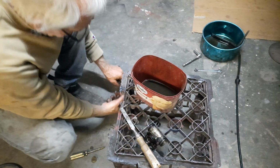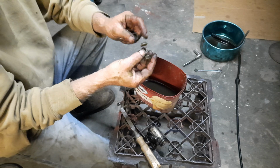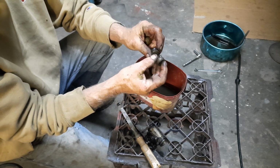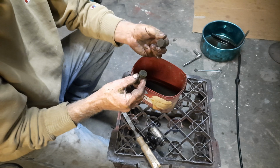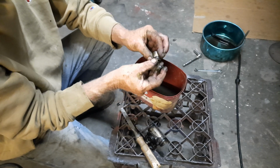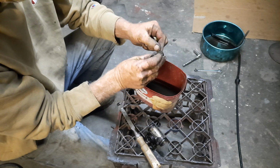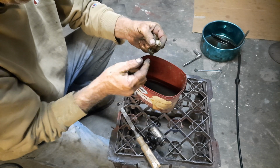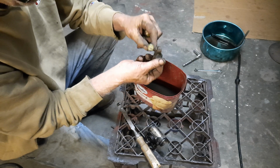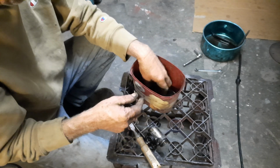Give that a wash and some cleaner metho here. These are what's inside it. You've got your spring, your nylon cups that your seals sit on, and then that pushes the dish part, which is for your pin or your brake shoes to run into. The flat of the seal sits against the flat of the piston. It's open so that the fluid, these have got holes inside them, so when your fluid comes in under pressure, it pushes out into the seal and expands the seal. So yeah, that's pretty much how that works. Anyway, won't bore you with cleaning that up.